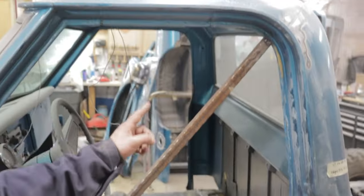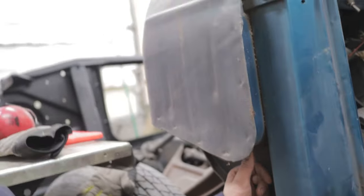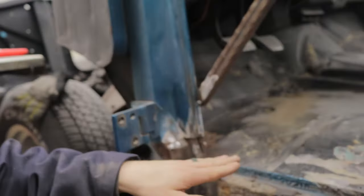I had the bright idea on the back side — I don't want a big chunk of metal welded in the center of the cab where I have to work around it. I'm going to be in there with air hammers, grinders, cut-off wheels. What I'll do is cut a piece of tubing to go up underneath the cowl, weld it here, and let it touch the floor — snug to the floor and touching the bottom of the cowl — and that will hold the front up. I don't plan on taking this off the jack stands until the cab is completely welded, so it doesn't matter if it's on the floor. That'll keep our height good and then I can hack out all the structural pieces at once without being afraid.